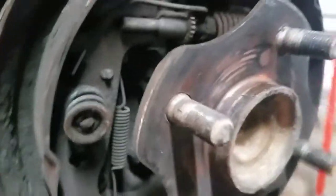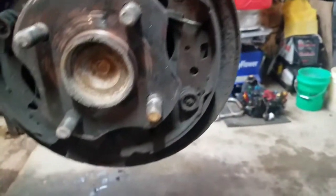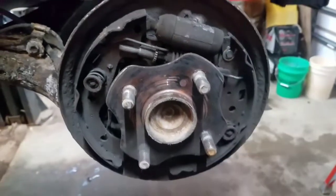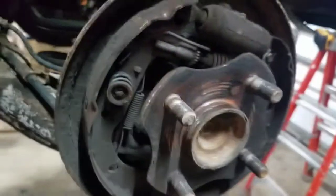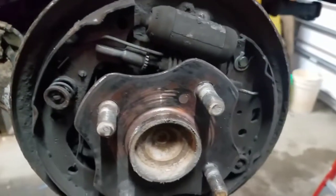These were grinding, so it's down to metal on metal — the drums, shoes, and spring kit all need replacing. First things first: when you take this off, I recommend taking a picture with your phone so you can keep track of how it was. Sometimes the previous person put it on wrong, but you can at least verify it against something.